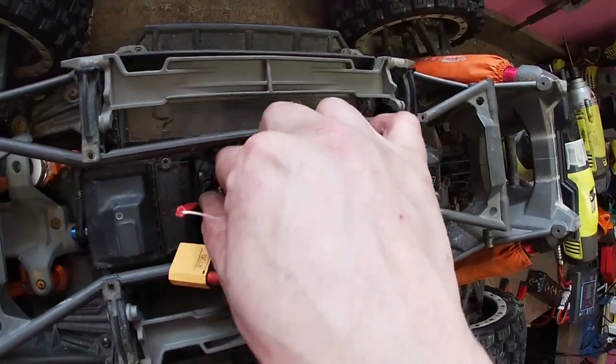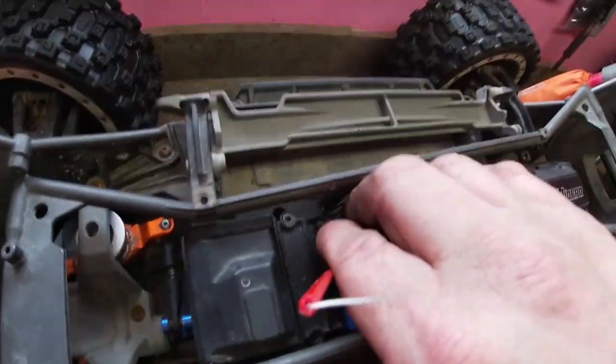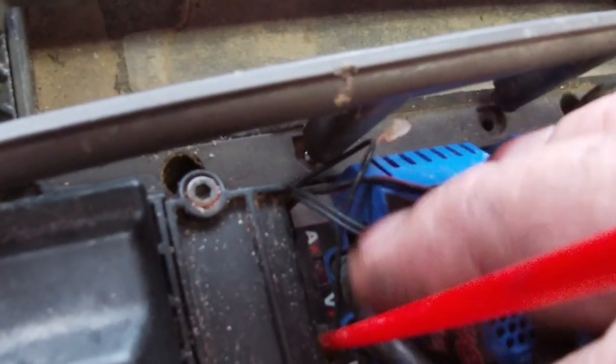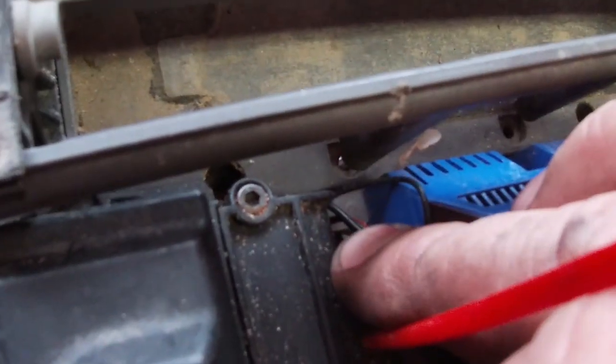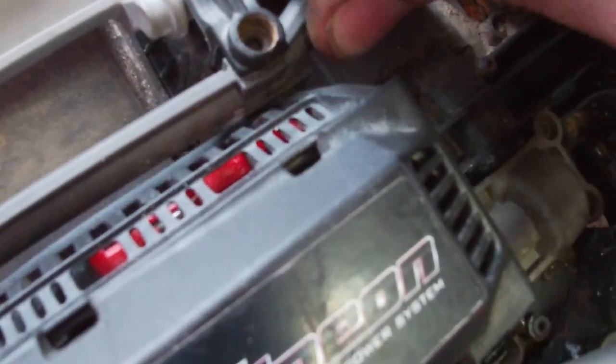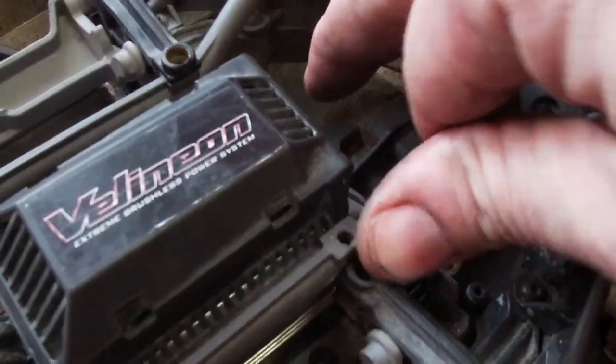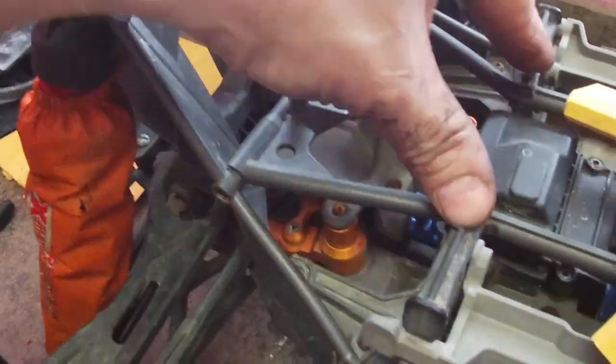What you want to do is get these wires pulled out from underneath of that spot when you press it down. Okay, and you push these over and back in. Slide the fan back that way. Flex this down and back in. These two already fell into place. Bam. Couple screws there, couple there, couple there, couple there, and 2 on the bottom.